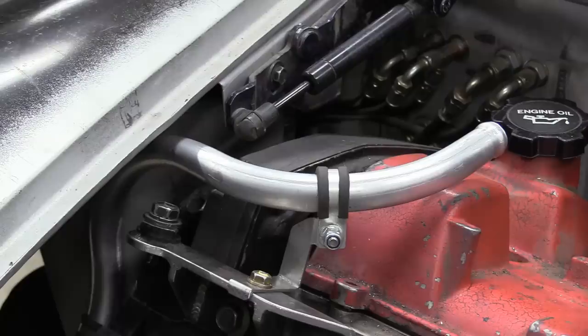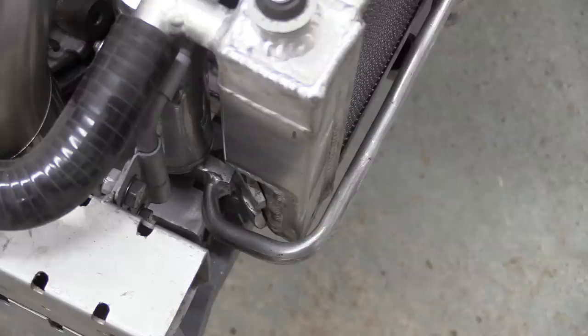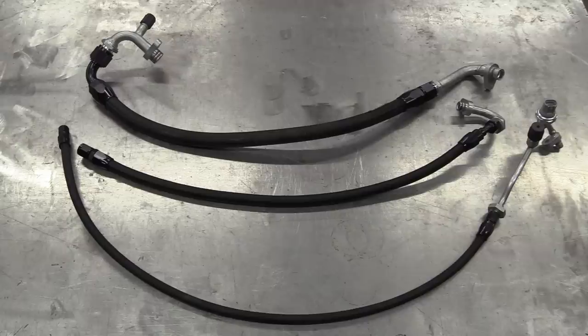At the end of the previous episode, we turned a Vauxhall Corsa radiator into a charge cooler heat exchanger. We'd made a damn good start on planning the complex task of installing the ECU and modified a Toyota Aygo AC condenser to fit the infinitesimally small space left at the front of the Mini. And while you were away, we cut up some expensive hose, added the aluminium AN fittings, and finished off the lines that connect the AC system together. So short of charging it up with some gas, that's another job checked off the list.